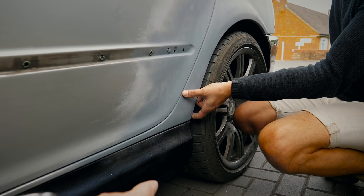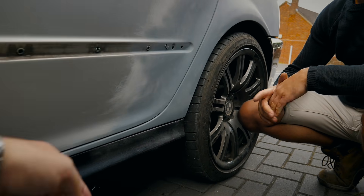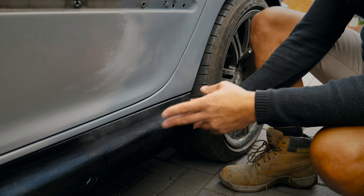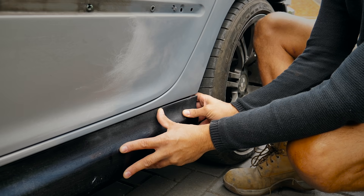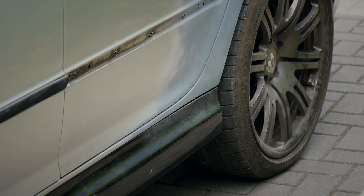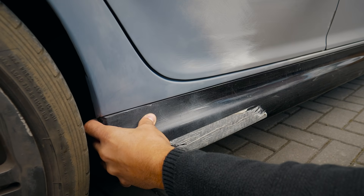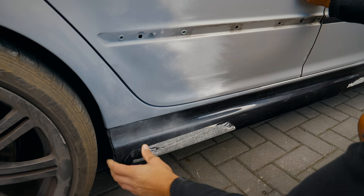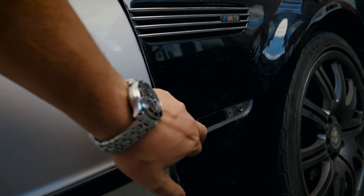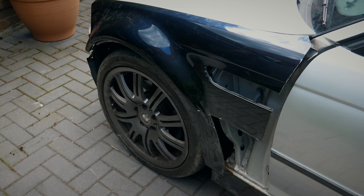So we've flared everything out. The problem being, if I were to lose this arch in — because normally this panel here is dead straight — it would have looked a bit wrong at the bottom. So we've ended up with a little bit of a flare which I think looks nice. What I've done to make sure this suits is put a bit of heat into the panel — because it's only plastic — and I've actually bent that panel out so it now follows the line of the car. If we hop over to the other side you'll see it hasn't been done yet — it sits in, there's a little gap. So eventually when I heat this up and pull it out it'll end up looking nice and symmetrical. It's just subtle — all these little bits of detail are what's important for this job, and it will be right.